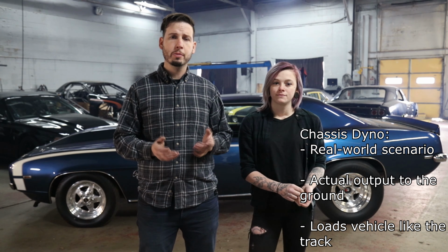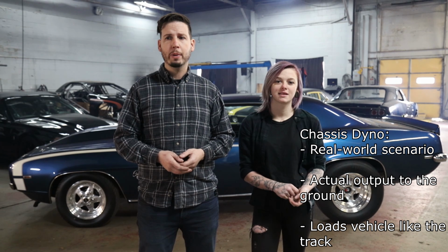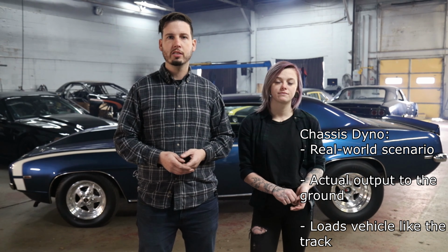So with something like this, where it has a Turbo 400 in it and is running about a 4.10 rear in it, we're going to see somewhere about a 20% loss between the rear and the transmission itself, which will give us a rear wheel horsepower of a guesstimate around 700 horsepower. So we're going to run it on the dyno, show you guys some numbers, and tell you what we did.